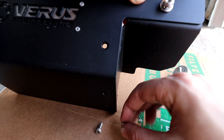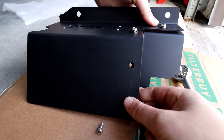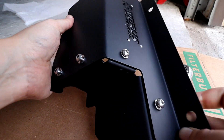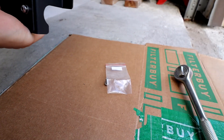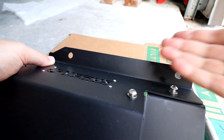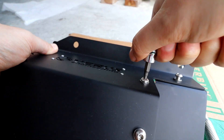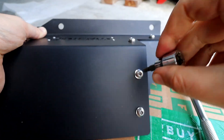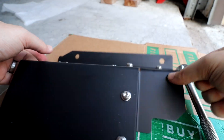I'll align these two holes, place one bolt here and two more here. I think these are the only places to connect them — they do give you an extra bolt and washer. I'm going to tighten these up, and then we have the two main bolts with the spacers that tie it to the car. You can use a hex socket and you don't really need to tighten these too much, just as long as it fits properly.